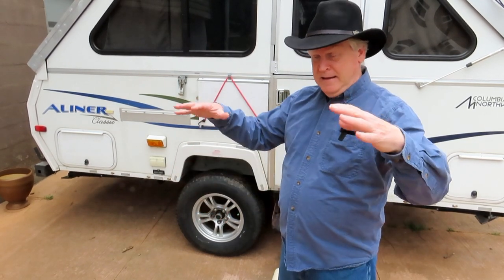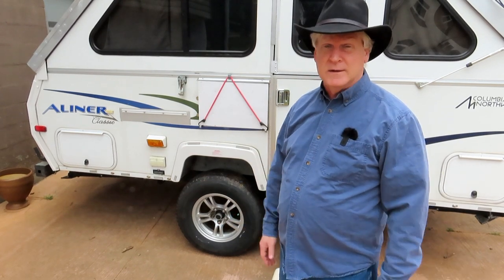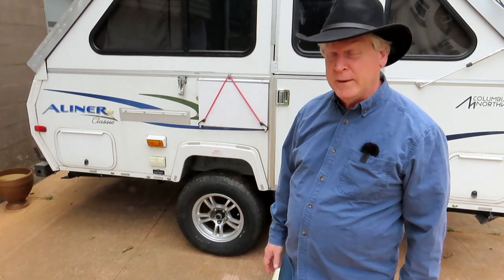I've got a whole video on how I changed the axle — it's really easy, don't ever think you can't do it. You put the trailer up on stands, loosen four bolts, the axle drops down, use a jack to lower it slowly, put in the new one, and lift it up. It costs about $500 for the axle and around $300 for freight, though if you're in Indiana you can probably pick it up for nearly free.